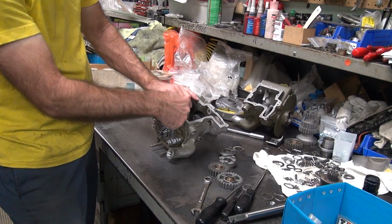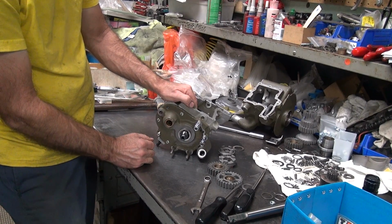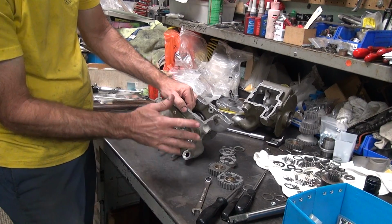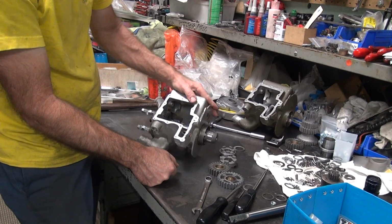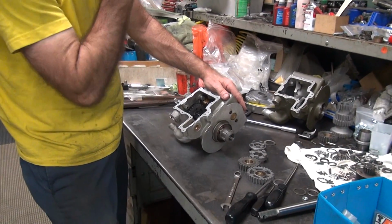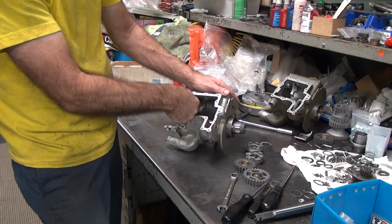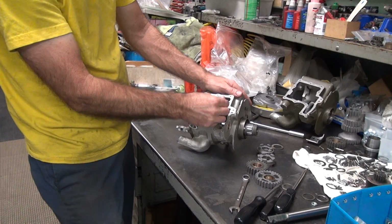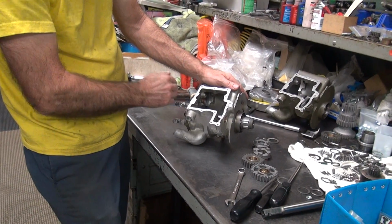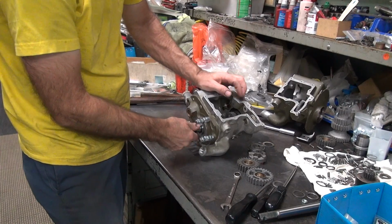If I take it out this side, it'll let the sprocket come back out a little bit further, so it'll have a little more clearance in here too. But they don't really rub in here anyway, so that's kind of a moot point. So it's a toss up on where you can take your clearances out. Now we already got a lot of extra clearance on this side because we put that thicker washer on the other side of the gear. We got the thick washer on this side. So we got washers, everything's shoving that way. So I think I'll drop this side down here on this side.